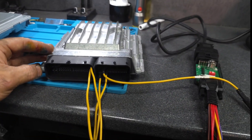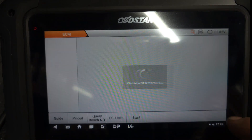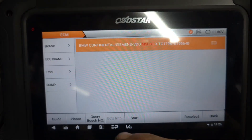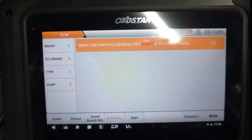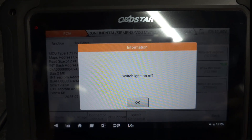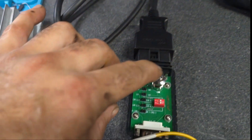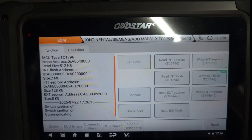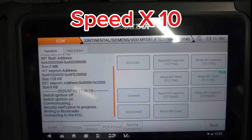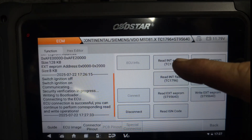I've done all the wiring and connector pinout. So I just put my camera right here. We go back and just say Start, say okay. Just say Connected — the ignition is off, the switch is off, okay, we just press okay. So we just switch the ignition on, say okay. As you can see everything is connected. So what we're going to do, we're going to read the EEPROM first.